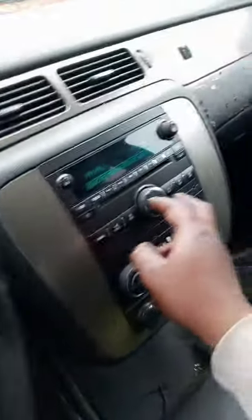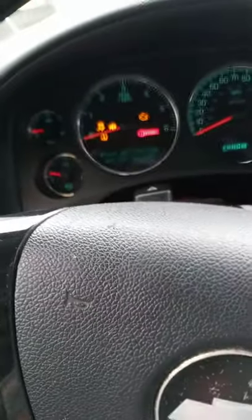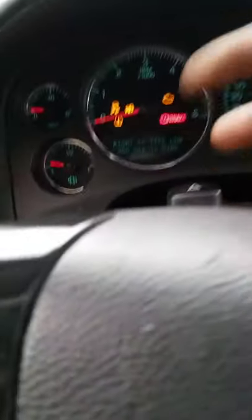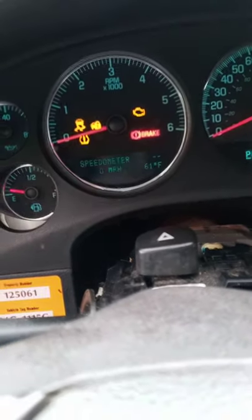When you go inside, the light stays on, crank the engine and nothing happens. Radio works, everything works. Stability track is on, doesn't say anything about service theft or control module. Everything is plugged in. I even wasted forty dollars on a new ignition switch.